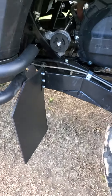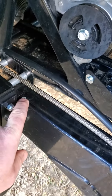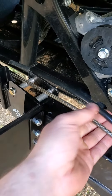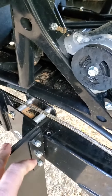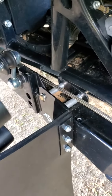They already come pre-assembled. All you have to do is remove that Phillips head screw there — I recommend using an impact driver because that thing is really in there. You remove that, pull the parking brake cable up, and basically slide it on. Put your spacers in, your bolts in, you're done. Just slide it all the way up to the back of the sway bar mount.